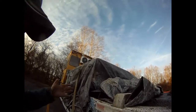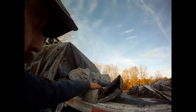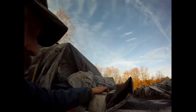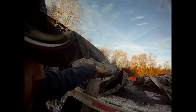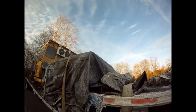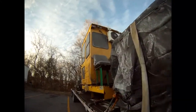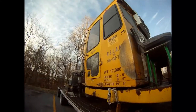So we couldn't even secure the tarp. We couldn't even put it down in between. So this is an emergency thing, and other people do it all the time regardless. Putting a 4x4 down, mashing it down with a 4-inch strap. Perfect. It hasn't moved a bit. And I added a couple extra bungees because in the temperatures I was in, stuff just stretches.